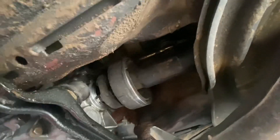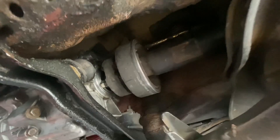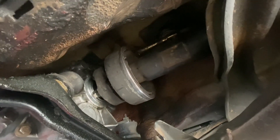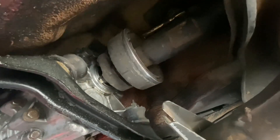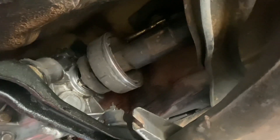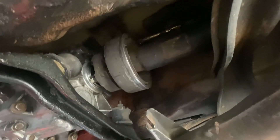The actual selector rod isn't bent quite enough, so it is rubbing on the vibration dampener. I'm going to have to pull the shifter stuff apart and take a look and probably pound a new seal in there. I don't think I have to take anything apart except take the linkage off. I don't think I have to drop the back of the trans, but it might help. We'll see when I get there.